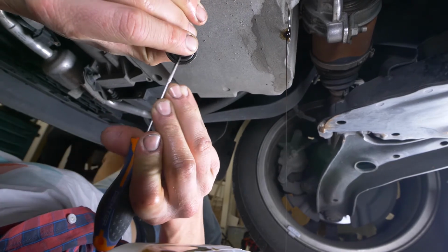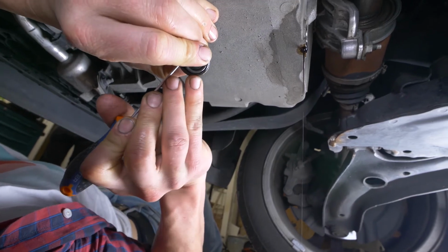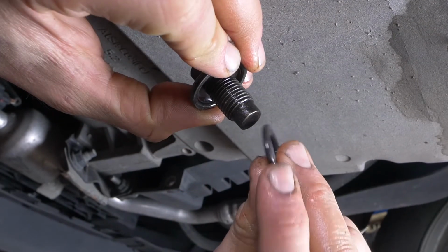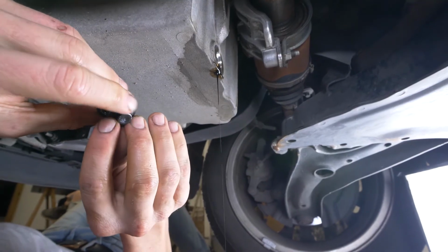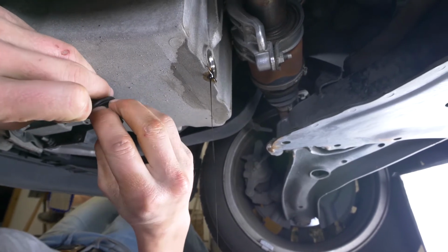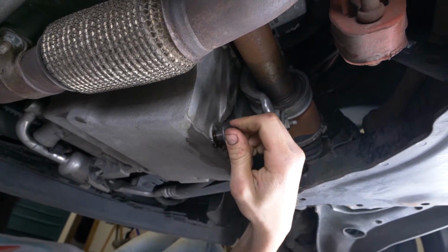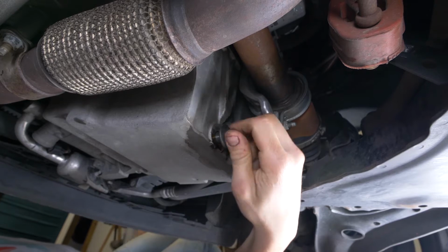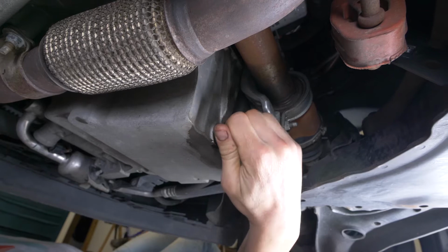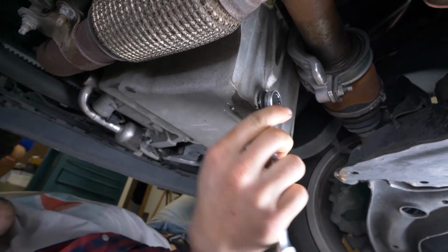During this time, remove the drain seal using a thin flathead screwdriver. Replace the drain seal with a new one. Then screw the drain nut back in. Start by hand. Then finish off using a wrench, without being overzealous, of course.